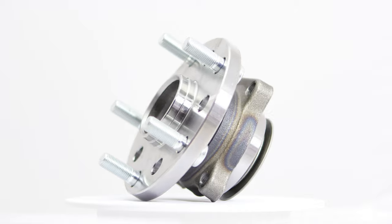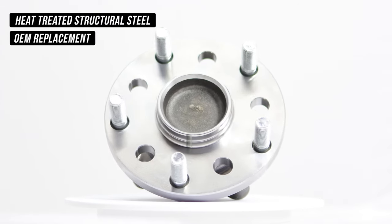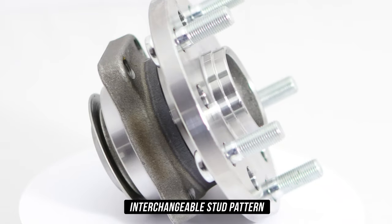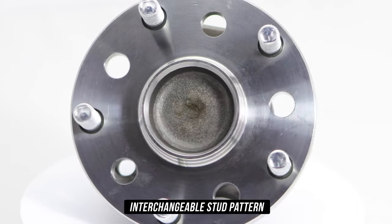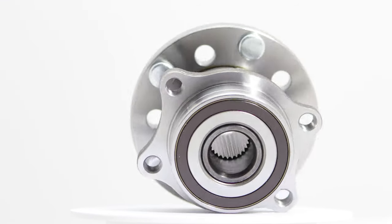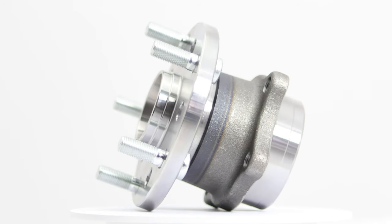The front and rear units have been blessed by utilizing heat treated structural steel in the main body and flange. We've also kept the OEM hub offset and tone wheel, retaining ABS compatibility and making these basically an OEM replacement in the correct lug pattern. One of the main awesome features is these being able to swing both ways — meaning you're able to change from 5x100, the original stud pattern, to 5x114.3 just by pressing your studs into whichever PCD you want. So if for whatever reason you want to go back, you can. Brake compatibility info for front and rear is covered on the website's product page.